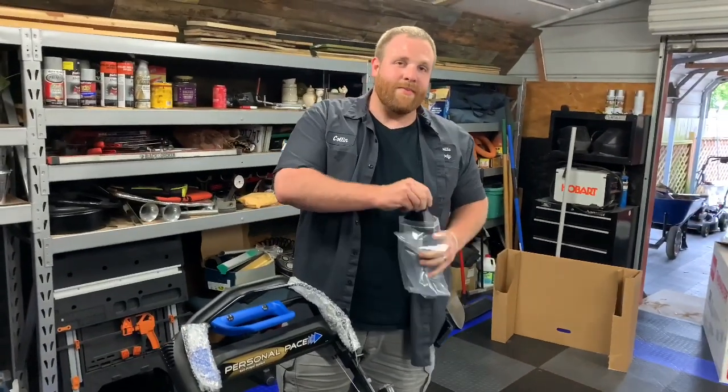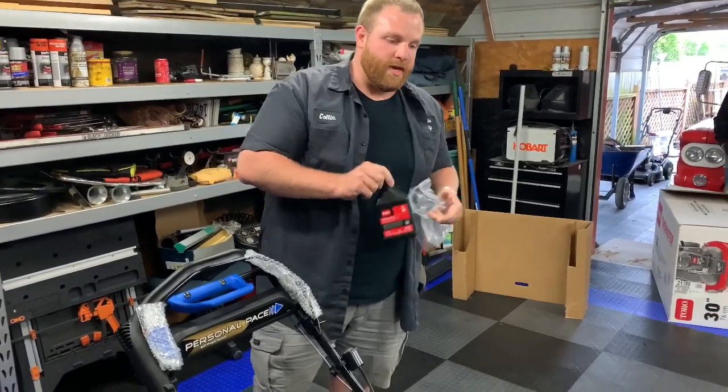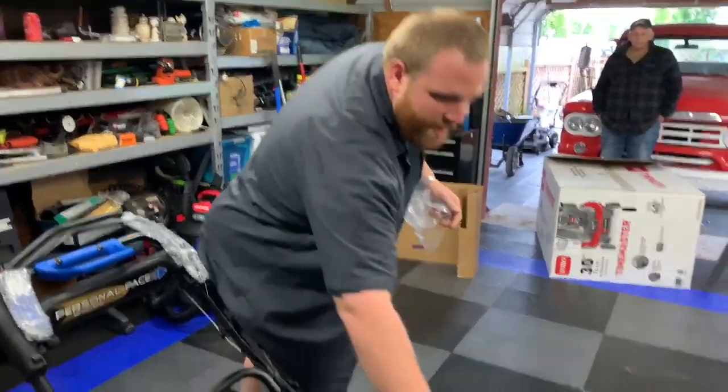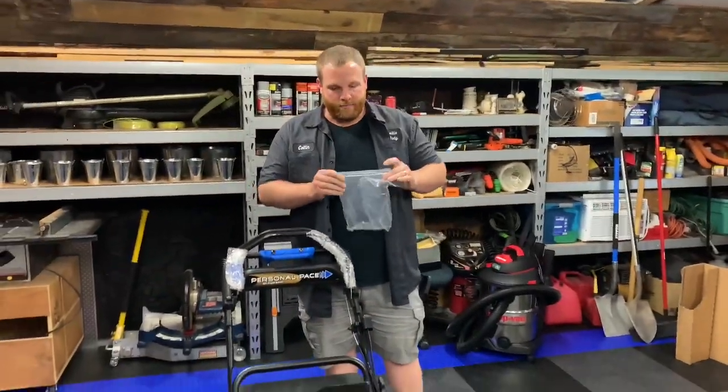I do not recommend the synthetic oil. Use what they give you for your first oil change to break it in. You'll want to do that for about 10 to 15 hours. Then I would switch to Mobil 1 10W30. That's what I run in mine. I'm Fury and I approve this message.